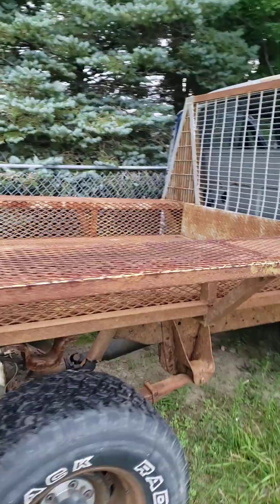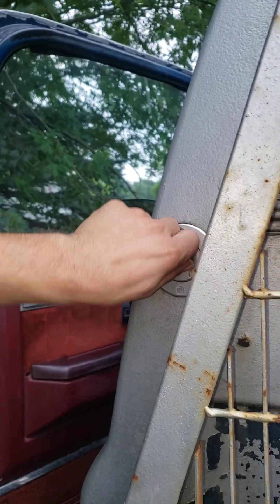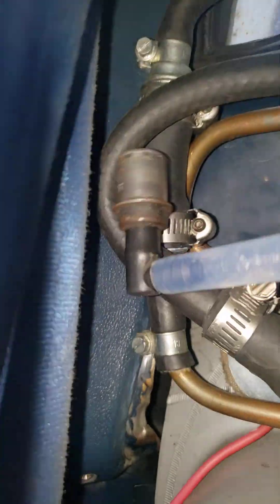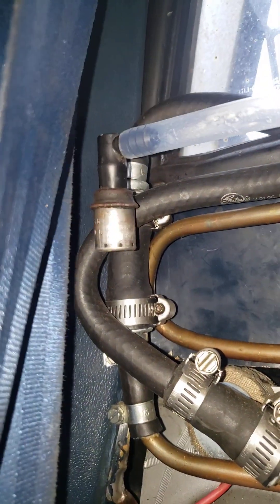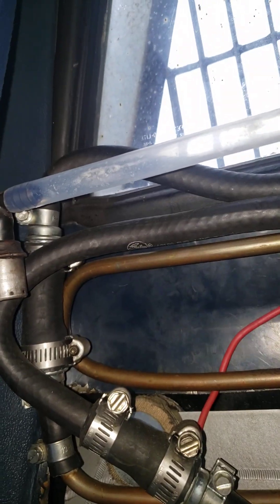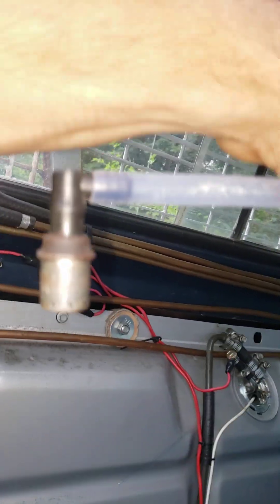To prevent the system just venting into the atmosphere — my system is closed, it's a sealed tank, completely sealed. I didn't want anything sticking out the side of the truck catching a tree branch, so I put it in the back. To prevent venting, I have a PCV facing upright and a PCV facing upside down. The upright one holds pressure — I tested it, it's like three PSI — and at three PSI it vents down.